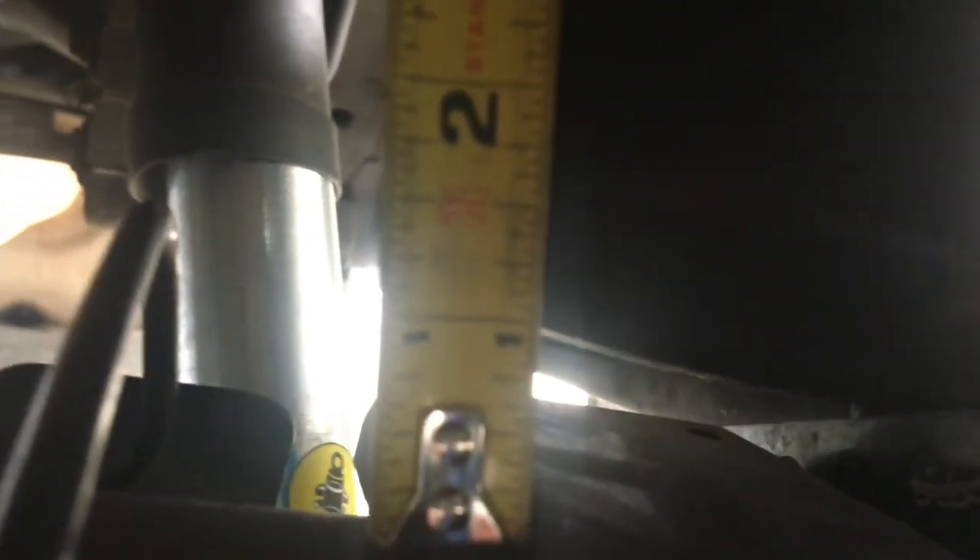We're hooked up to the trailer now. It doesn't have a car in it but it's not empty per se because I do have the gear we use for hauling a car, so it's 3,900 pounds — not 3,600. It looks like we're right at between three-quarters and seven-eighths of an inch. I don't actually want it touching all the time; I just want it there as a safety stop, working in concert with the Roadmasters. I'd like the Roadmasters to take most of the load along with the factory suspension, and these just be the super saver.